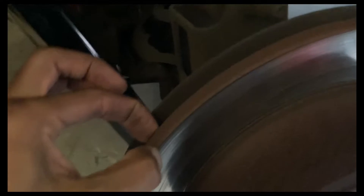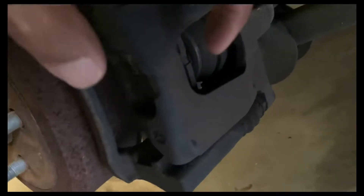From what I can see already, that pad is about gone for sure. It's pretty close but the main thing I want to make sure is that there's no grooves in the rotor. It's about to have grooves but it's still smooth — no actual cuts. The right way to do this would be to actually measure it but I don't have specialty tools. I'm just gonna put some pads on it. I mean, I got no pad left — there's nothing there.